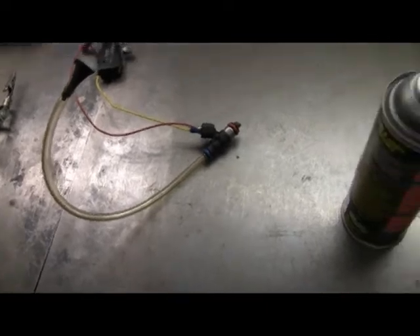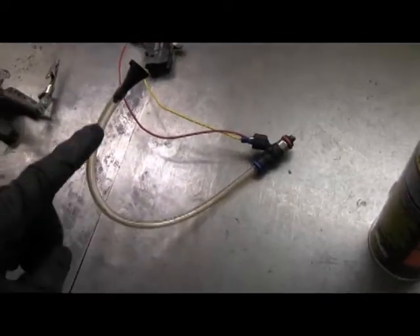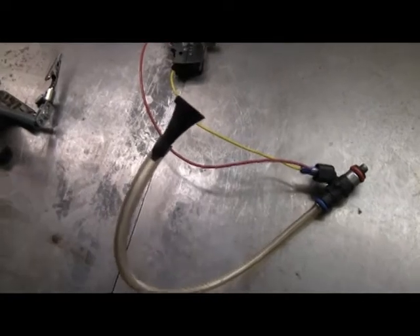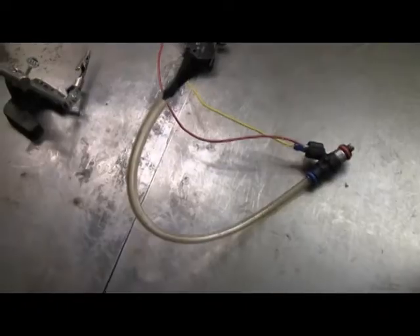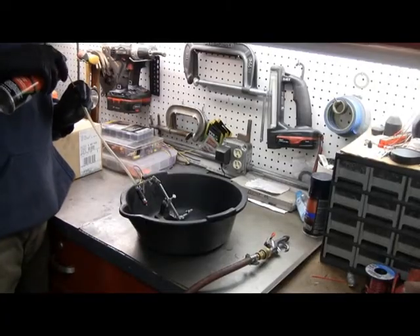I've seen most people try to use the aerosol from the can itself as the pressure, but I couldn't come up with a contraption that would connect that small tube to the inlet of the injector without blowing off under pressure. So I'll show you what I did. I had gas line from the weed trimmer and put that on the injector inlet — it fits really nice and tight. Then this is like a little funnel: it's actually one of the light directional attachments from a doctor's ear scope. It fits real tight into the end of this hose. I'm going to fill up this hose with carb cleaner, then use compressed air on the end to put a little bit of pressure into it, and pulse the valve with the switch to make sure it's clean.